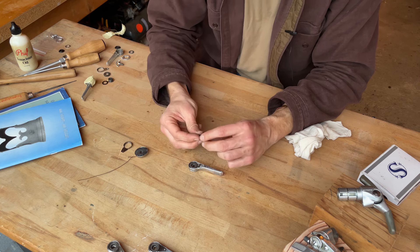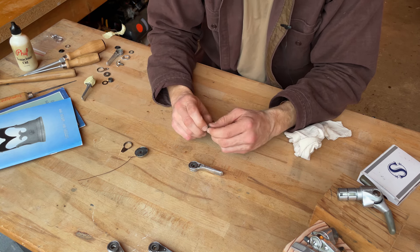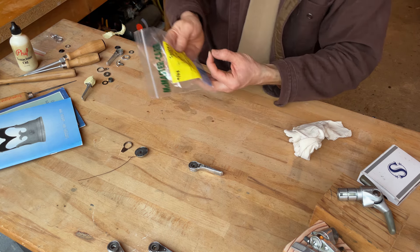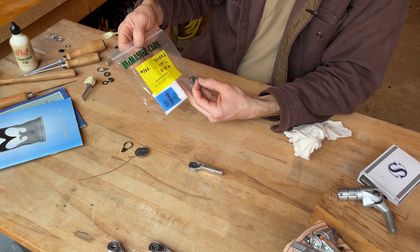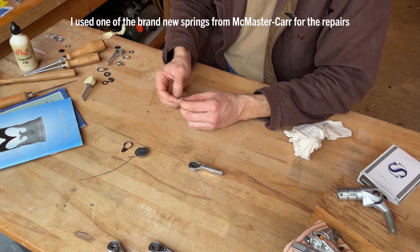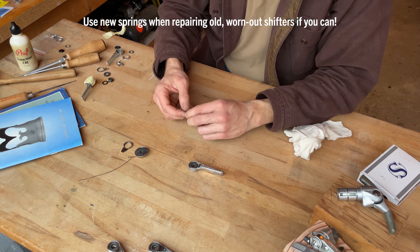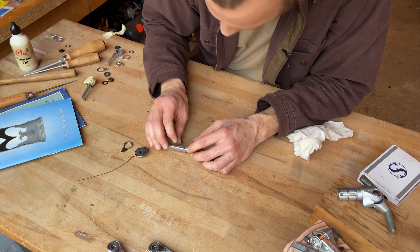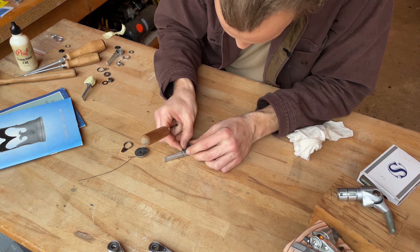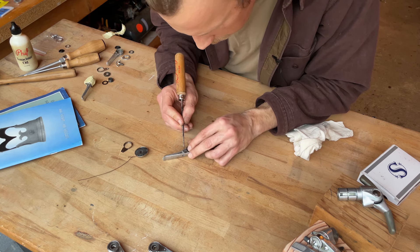These springs can and will fly out of your fingers and go across your shop and you will maybe probably never see one again. Fortunately, I have found a replacement from McMaster-Carr, and I will put a link in the description — it's a very fine functional replacement for these springs. The ones from McMaster are a little bit stronger; the steel is a bit stronger, not quite as soft and springy, but they are a worthy replacement. So you're going to want to very carefully finesse your spring into place using an ice pick.